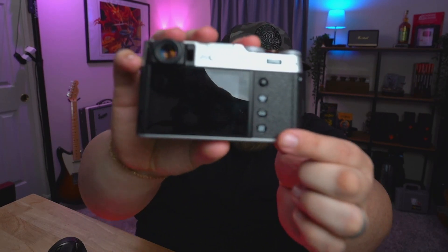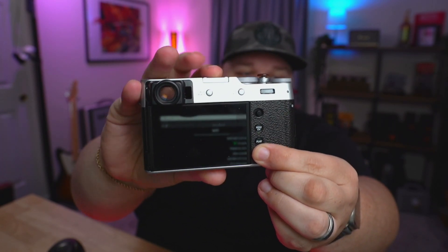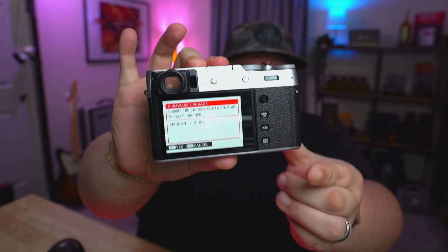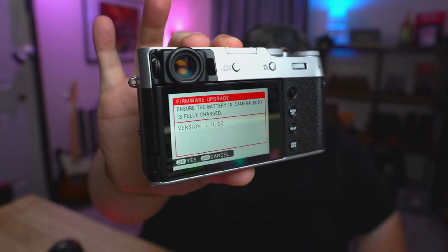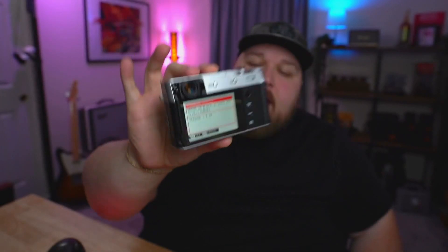Then eject the SD card and put it in your camera. Once you have the SD card in your camera, this is really simple — you're just going to hold down the display and back button while turning on the camera, and you're going to get a menu pop up. It'll tell you the version of firmware that is on your camera, and if it is not 3.0, you're able to simply update the firmware from there. Once it's done, turn your camera off, turn it back on, and you're good to go and can connect to the new app.